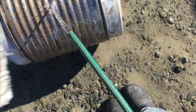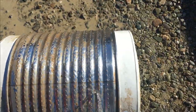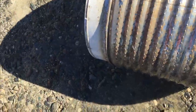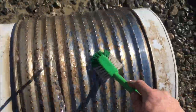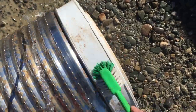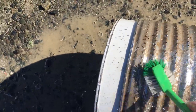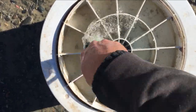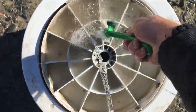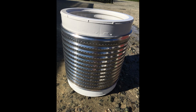To clean the inner bowl we're going to use the same scrubbing brush. I don't use a cloth because these holes have been punched through from inside the bowl and leave sharp edges like a cheese grater — you'll take the skin off your knuckles very quickly. The soap scum becomes quite soft once it's wet. If you have lime scale in your area it may be a bit harder to get off. For soap scum, just get it wet with a hose on low flow, leave it for a minute or two, then come back and start scrubbing while keeping water flowing. If anything's really stubborn, don't worry too much — if it won't come off with scrubbing and water it won't come off during the wash. The secret to getting it really shiny is to use a water blaster, which is what I do at the workshop. Otherwise a scrubbing brush does fine.